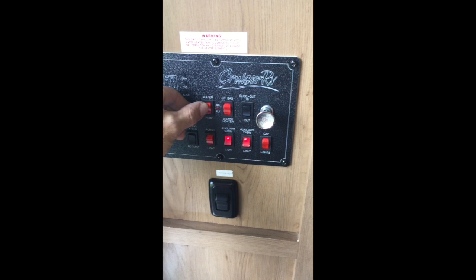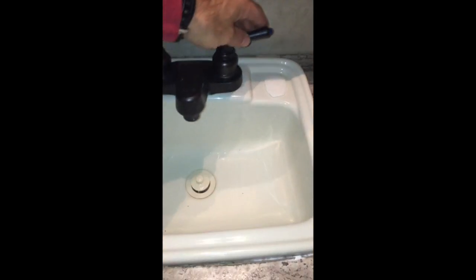Then I'm going to stick in all these gallons of antifreeze I got. Yeah, my valve is really hard to see. I'm going to do that, and I'm going to shut this video down and do that. Now go turn on your water pump so you can suck the RV antifreeze out of the 1 gallon jugs. This should only take about 2 to 3 jugs, depending on the size of your camper, if you have one of them winterization tubes.